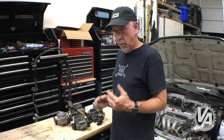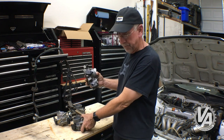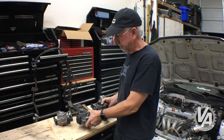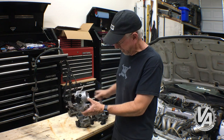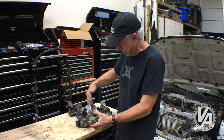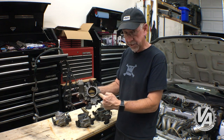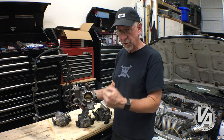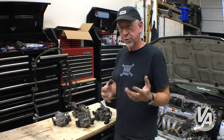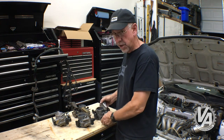The real reason we're talking about this has to do with the throttle position sensor. The throttle position sensors are not the same. If you look at both the RSX Type S and the Accord Euro R, you'll notice these are clocked the same — they look the same, they are the same. The Accord throttle body is clocked a little bit differently; it's on the same side but operates the same. This other one is on the opposite side of the throttle body, and because it's on the opposite side, when you open the throttle body it opens backwards compared to the others — which means it's also wired backwards. So if you're trying to use a CRV harness or base RSX harness with one of these other throttle bodies, you're going to need to rewire the TPS.